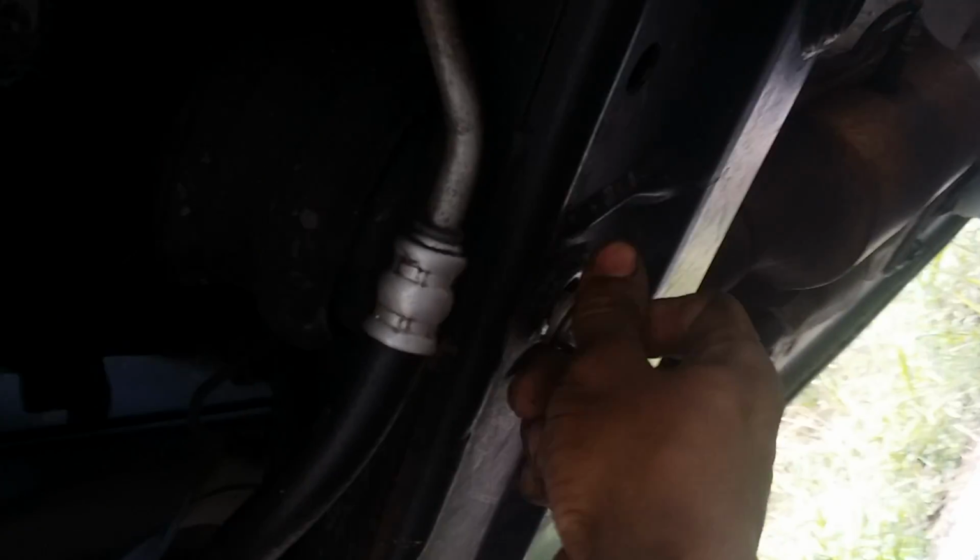And then after that, if I need to, I'll use another jack on the cradle if I can't get enough pressure or if there's not enough thread to reach the hole up there. And I'm going to slowly raise the cradle back up. And then once that bolt has come all the way through, secure it down and check all your other connections. I also loosened this one up back here, the rear motor mount, to get a little extra clearance. I will secure that back, front one back, make sure everything is secure. The 10mm bolt, I don't know how necessary that one is, but I'll also put that one back on.